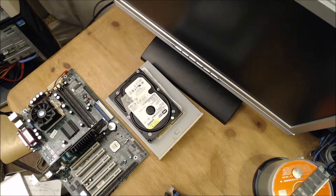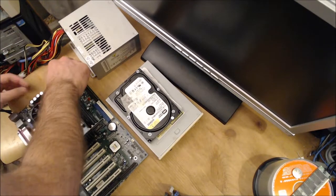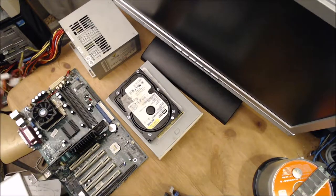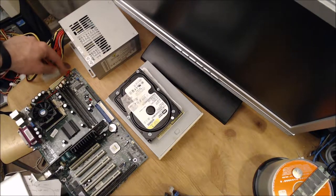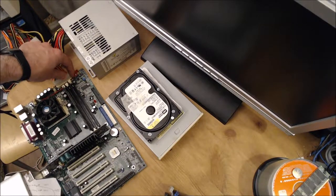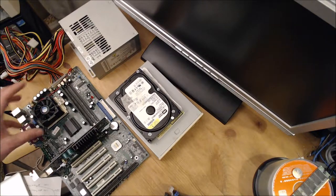We've got a graphics card, we've got memory. Graphics card, memory, processor, power. This is a 20 pin power connector. So this has got a notch here, and this notch clicks into place, being careful not to get this wire, clicks and locks into place. So you don't have to plug in an extra connector anywhere for any other power on this motherboard.